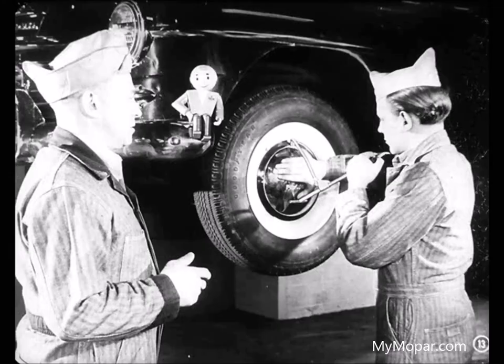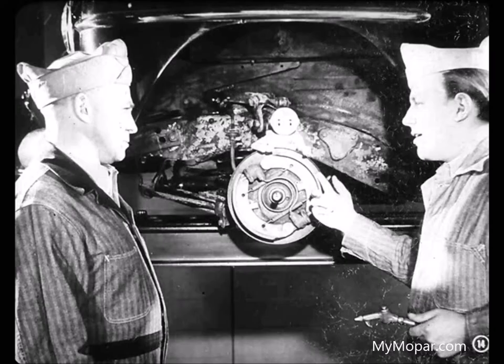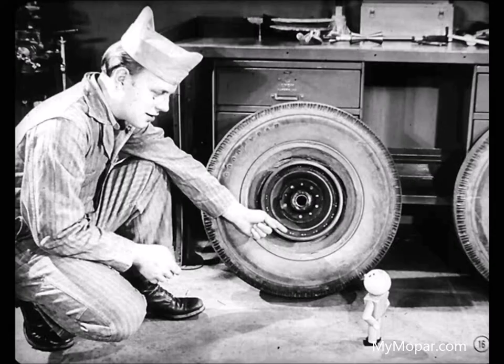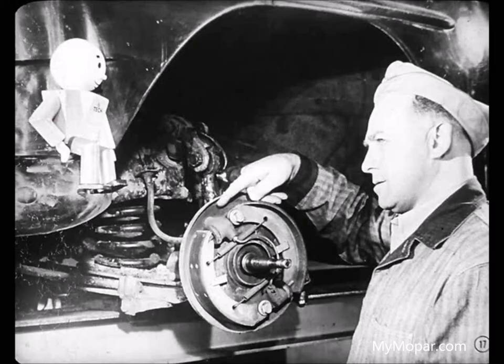Suppose you pull the wheels and drums, and we can take a look at the brake. There you are, Larry. And I've blown out all the dust and dirt, too. Yeah, that's fine, Joe. Well, there's no sign of brake fluid or grease leaks. How about the drums? I've checked the drums, and they both look okay. Fine, Joe. Are there any signs of the drums rubbing on the support plate, Larry? No, Tech, there aren't any signs of scraping.